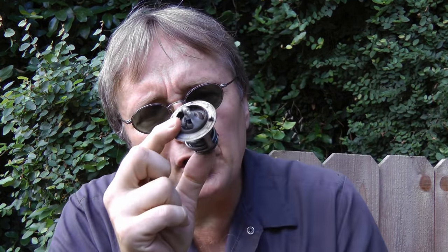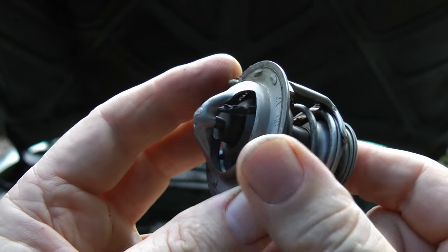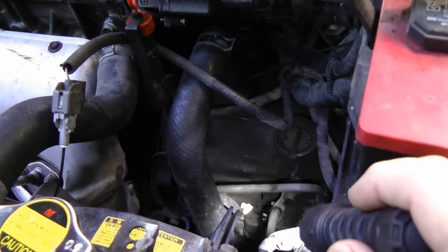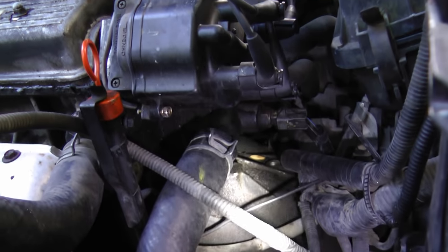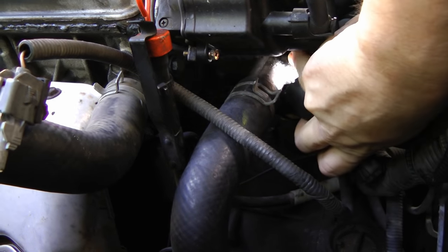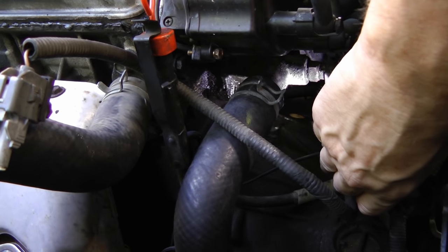But let's say the fans are working fine — well then you might have a bad thermostat. These thermostats close so the engine warms up, and when it gets hot they're supposed to open up, and sometimes they stick. Most thermostats are pretty easy to get to. On this Toyota you just follow the bottom radiator hose and there's the thermostat housing back there. It just has a bolt on the top and a bolt on the bottom — you pull it out and replace the thermostat.